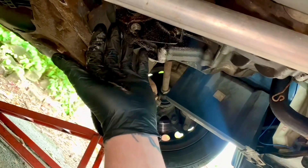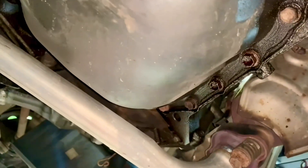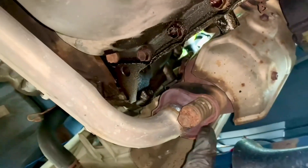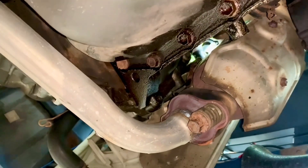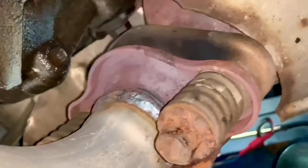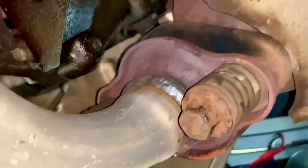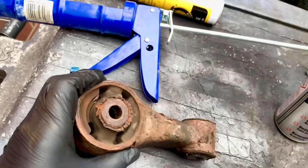This is completely unrelated to what I'm doing but I'll point it out while I'm here: with the engine mount off I can now exaggerate quite easily the way the engine moves when torque is applied in either direction — it rocks backwards and forwards. That is why we have the spring-loaded exhaust joint here, which allows an amount of flex. I thought that was interesting so I just thought I'd mention it.